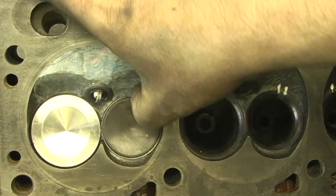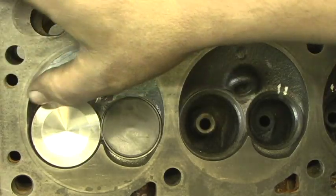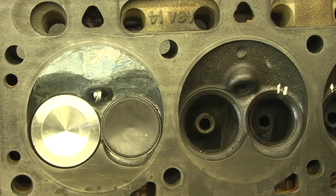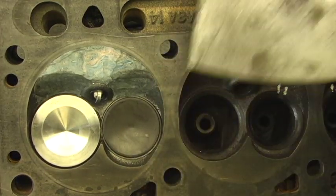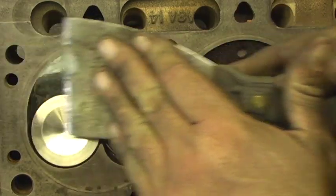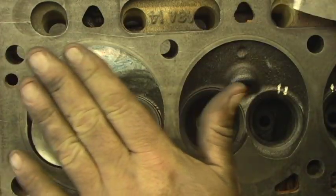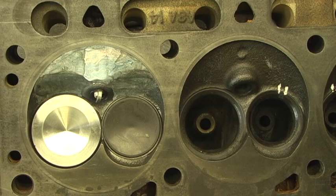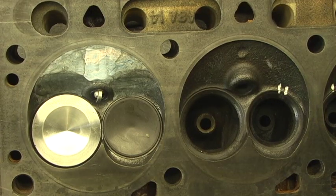The main thing is unshrouding and kicking the air up, giving it almost like a Venturi effect, if you will. Then I just come in here with my putty knife and do a little trim and it just levels it out. I'll get a couple of pictures and then we'll carry it over to the table and CC it.